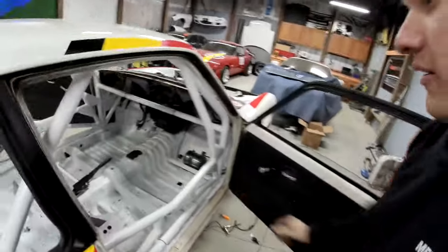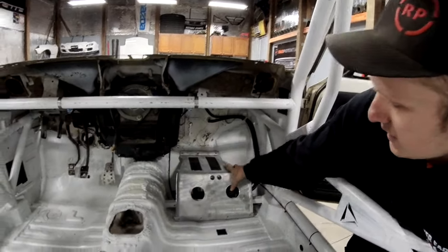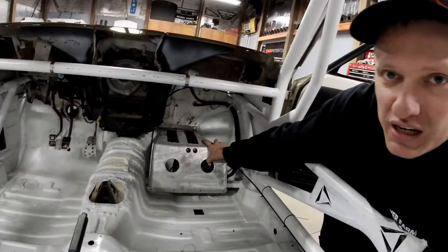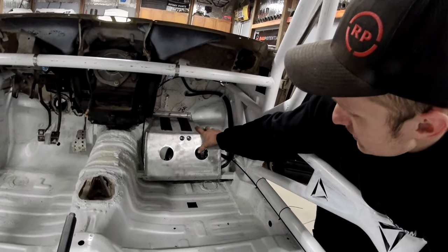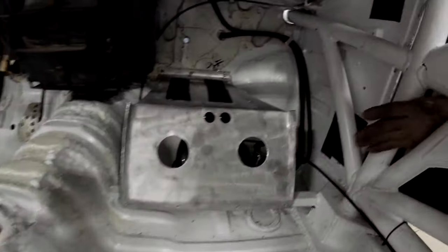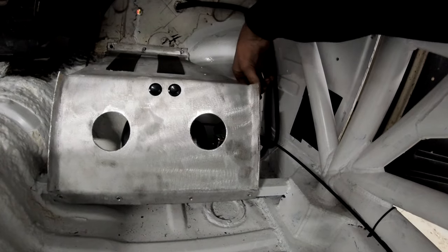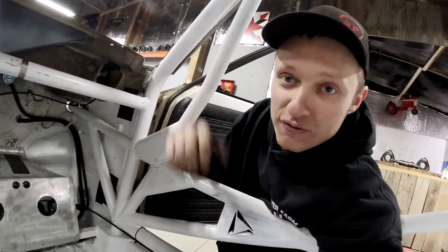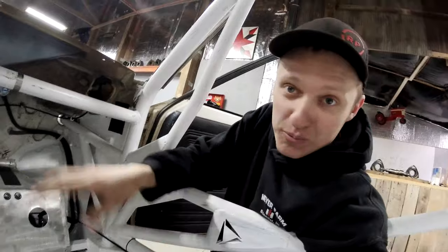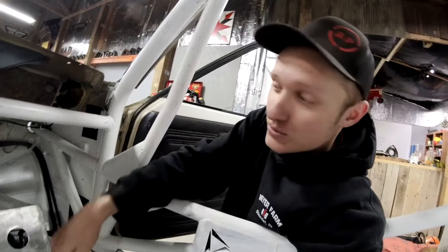What I wanted to show you as well is Calvin's foot plate and just how easy it is to put on. Studs in the firewall, line those up. I'm just gonna set this here. But you can see the fire suppression system back underneath the foot plate. There's plenty of room to reach around over here and pull the pin before the event. There's a pin that keeps the activators from activating. So you'll put that pin in for transport, not racing, the whole deal. Probably put a slick little remove before flight tag on it so we can pull it off.